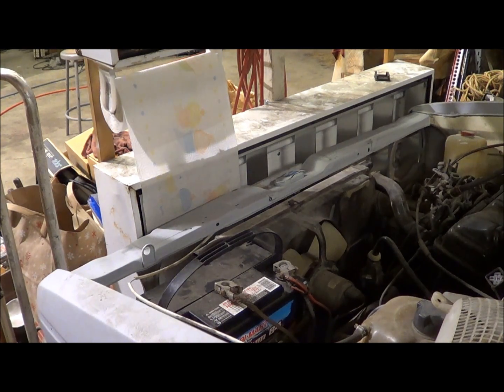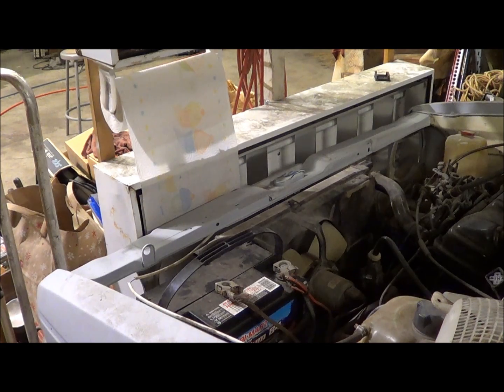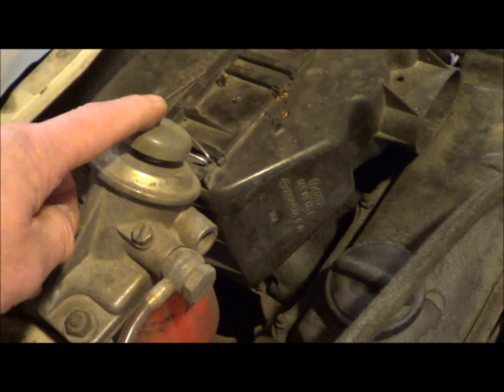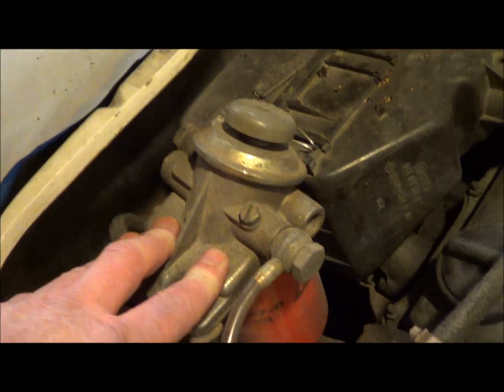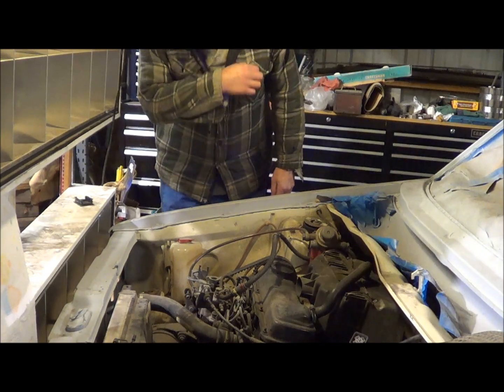I got no idea what that beep is about, but before I can even attempt to fire it anyway I got to get a prime to the pump, because it's been sitting for years and it's possible that the injector pump is out of fuel. This is a '77 Rabbit — it's an old German one, round headlight — and it has this filter setup here that has a hand prime on it, so you can pump this and suck the fuel up from your tank, fill the filter up, and kind of prime the pump. I'm going to go ahead and do that until I see fluid in this used-to-be-clear tube, get some diesel down to the pump, and then we'll give it a crank.